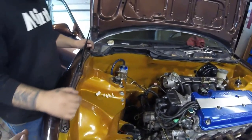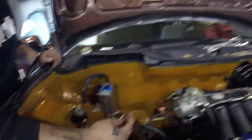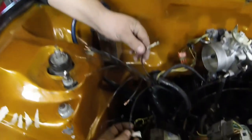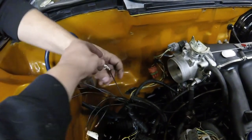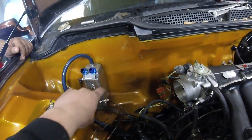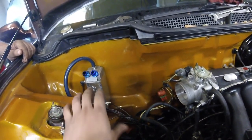Now we are figuring out what all these open wires are. So far we've got injector one and four labeled — this is the power or ground for injector one and this is number four. Now we're gonna find out where two and three are, and I'm assuming the rest are just gonna be the other side of the injector, which doesn't matter where they go. This random wire right here and this ring terminal down here I'm still unsure of, so we're gonna have to trace every single one of these wires back and see exactly where they go.